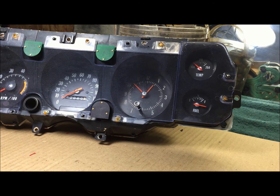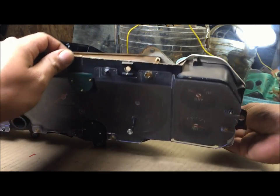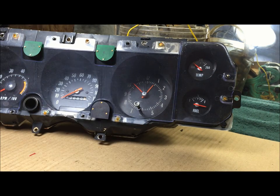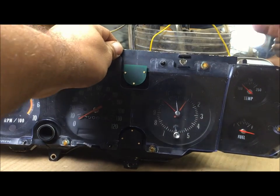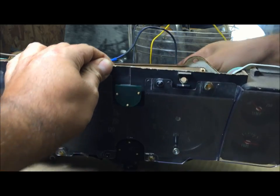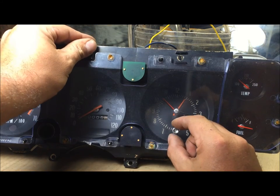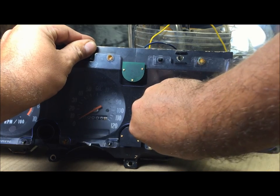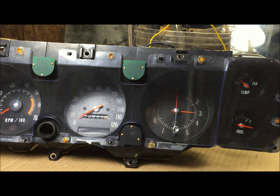We're going to test the clock and make sure it works. I'm going to rewire the harness part so the clock comes on with the key - I don't want it running 24 hours a day doing what the old clock did, melting the points. So we're going to bump it with power like turning the car on. This clock has been sitting for two or three months - and it came to life. We'd just adjust the time. Every time we drive it we're gonna have to do this, but it's fun just to have it working in there. That's something pretty cool.